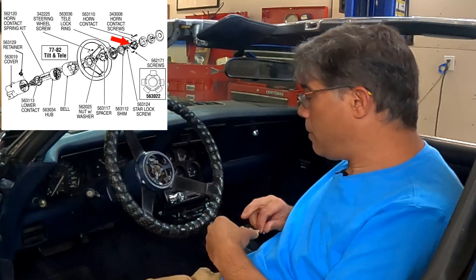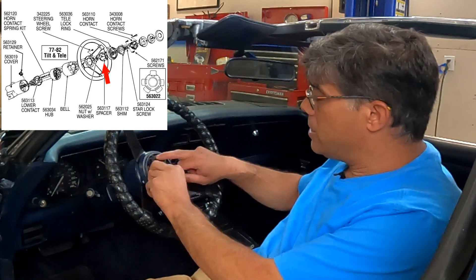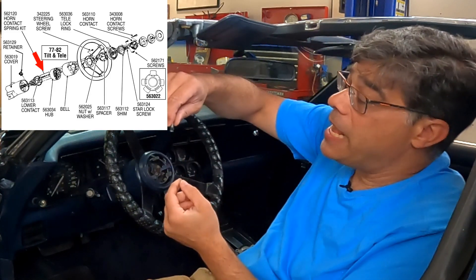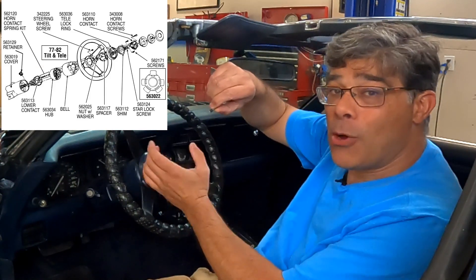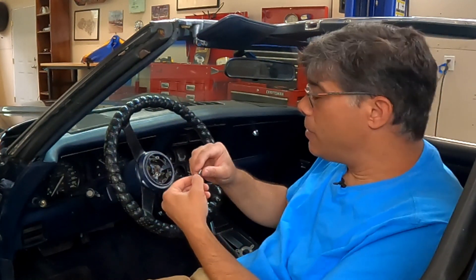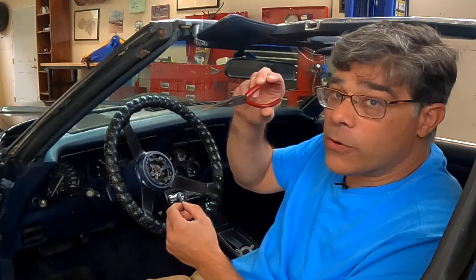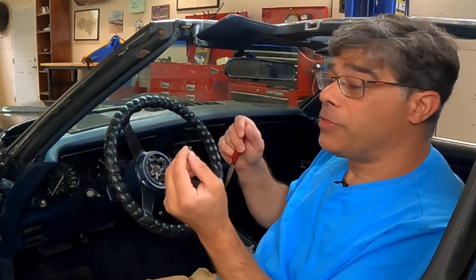You will notice that there will be the spacer left behind, and then right down here may be either a spring or the contact. It is very common when the inner contacts or upper contact blow apart that this post under spring tension will shoot out. So take a needle nose pliers, make sure you have your spring, and then use it to put the post back in.